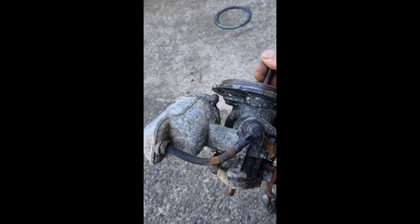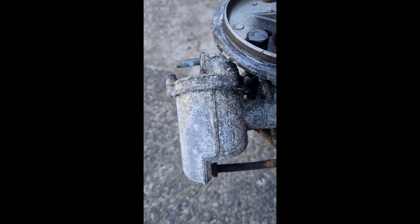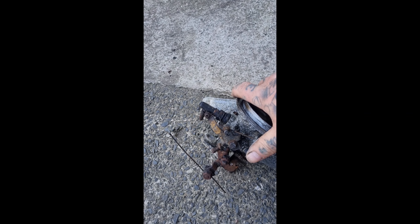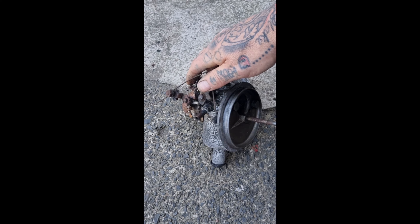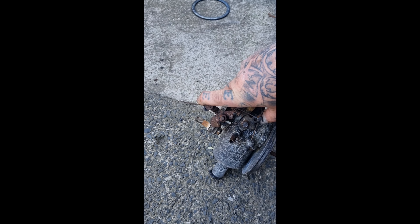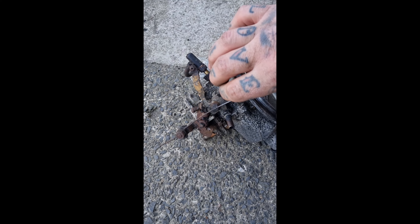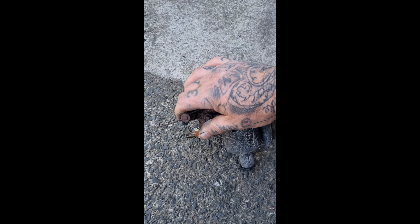So I'm going to take this tube off here at the bottom. We'll check in there, in the float bowl, and we'll see if we can get this mechanism to move. As you can see, I can't get a throttle — is that a throttle? No, throttle won't move. I managed to get the choke to move a bit. The choke's seized, but this main throttle is absolutely rock solid.